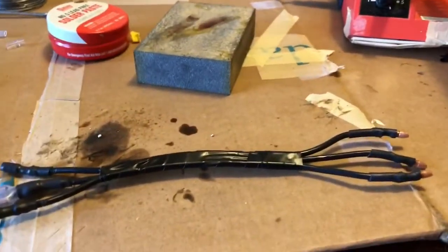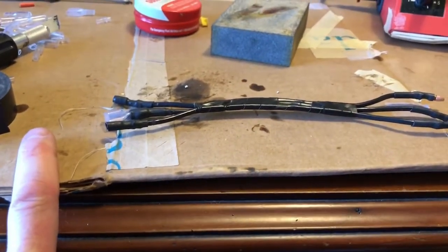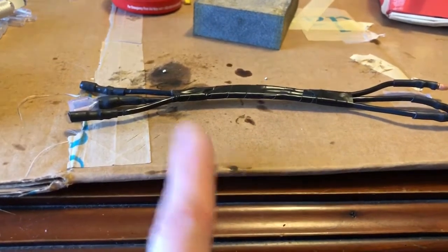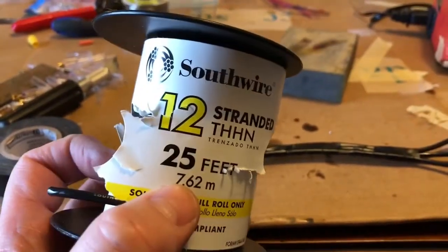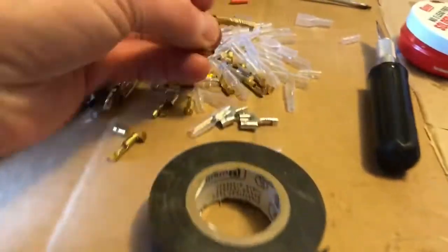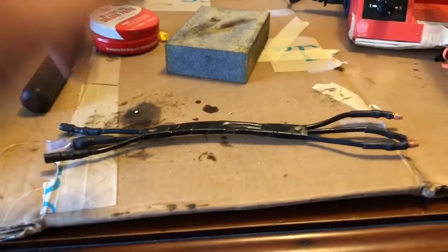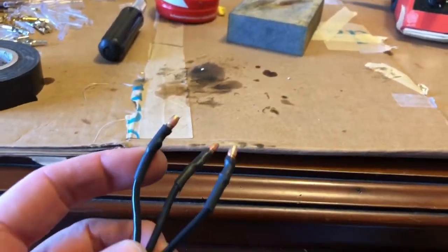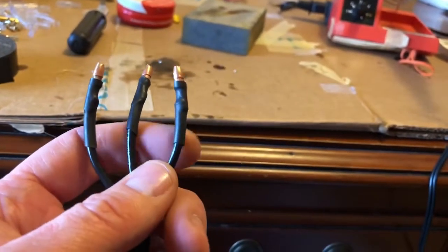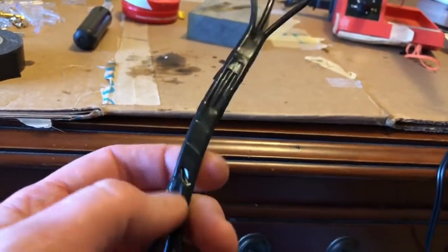Just wanted to show how I'm making this little rear harness — it goes between that connector and the rear turn signal lights. I took 12-gauge wire (more than needed but it's what I had), measured out eight inches, and cut three wires. I soldered my connections so you don't have to worry about them coming loose, then used shrink wrap tube over the ends.